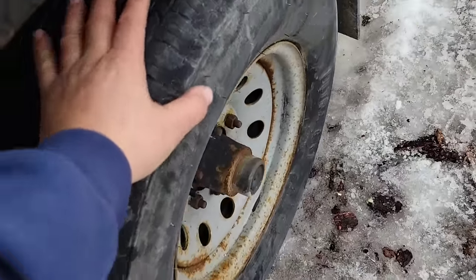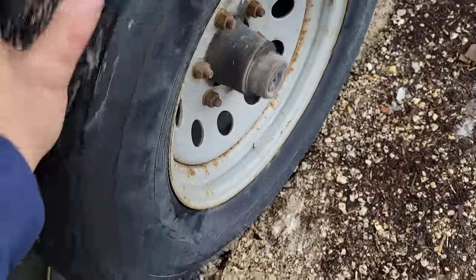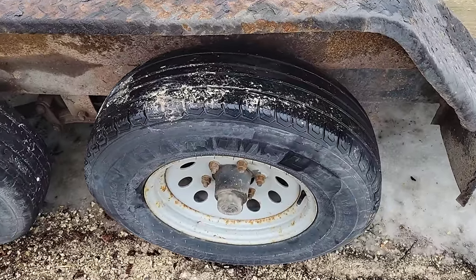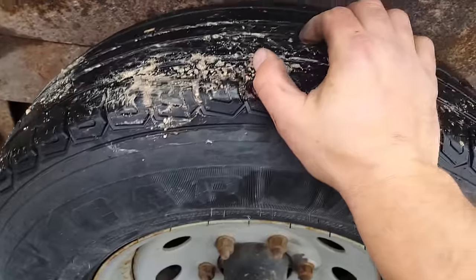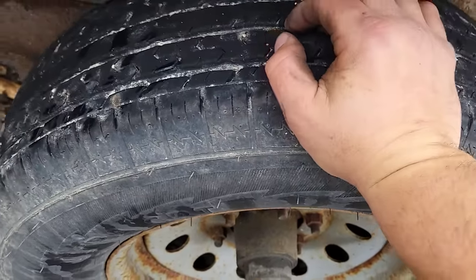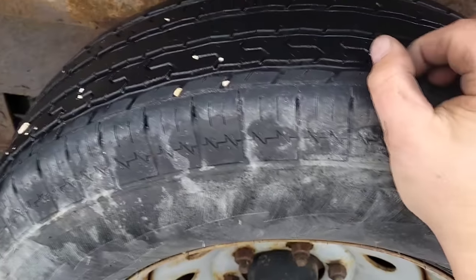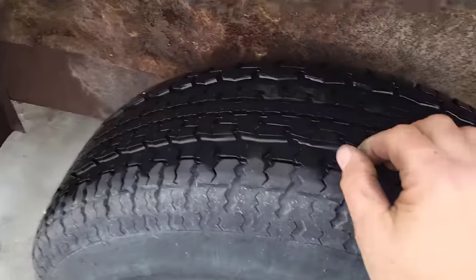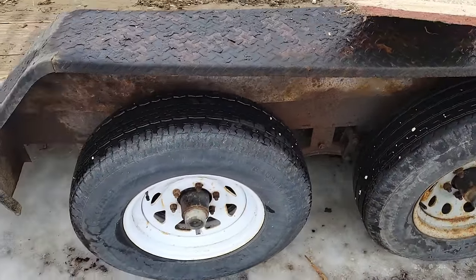We have no brakes - well, this one feels like it's dragging a little bit. So the brakes are definitely not working. There's another way to check them - I'll show you that when I rip one of these apart. Look how loose that is - if I keep using this like this it's going to break. This side has no end play - it's too tight, it's one of the ones that got hot. This one's got a little bit of end play. So: little end play, little end play, lots of slop on the front one.